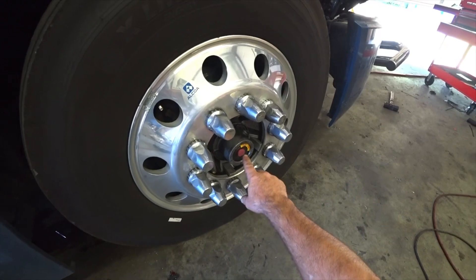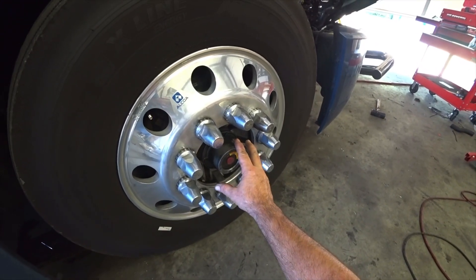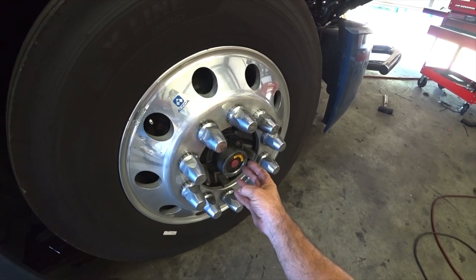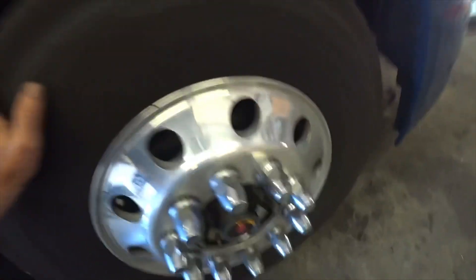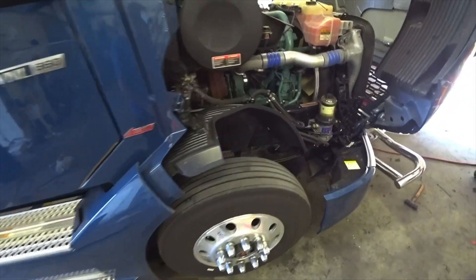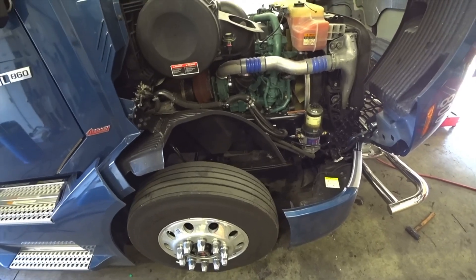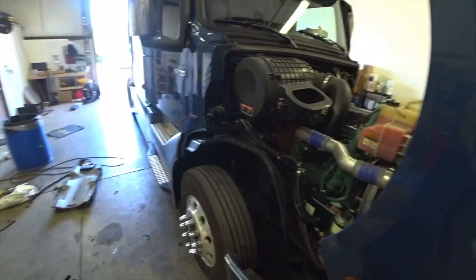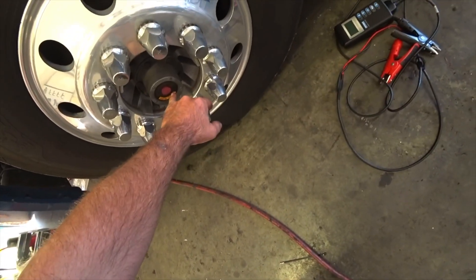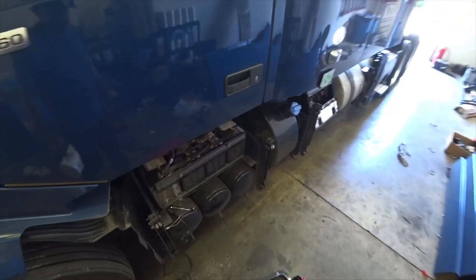What's happening is he's overfilling this and when pressure builds up, that little pinhole releases the pressure and a fine mist of oil comes out. It's releasing out here and doing the job it's supposed to do, but these are overfilled - it's all the way up to the rubber. I don't see the gasket leaking and the inside seal isn't leaking. The oil level just needs to be lower - both sides are the same so I know he's been topping these off.